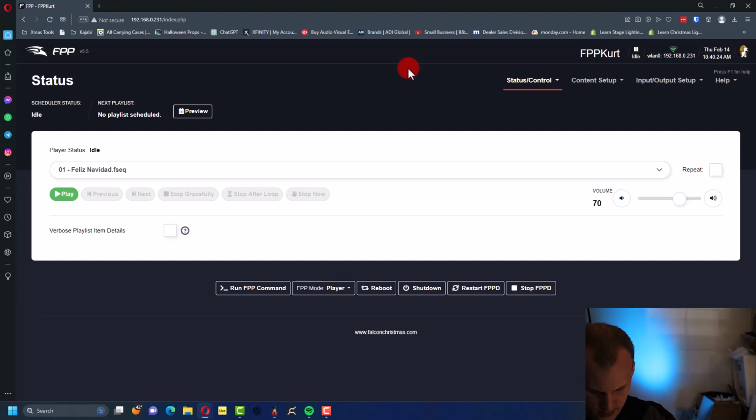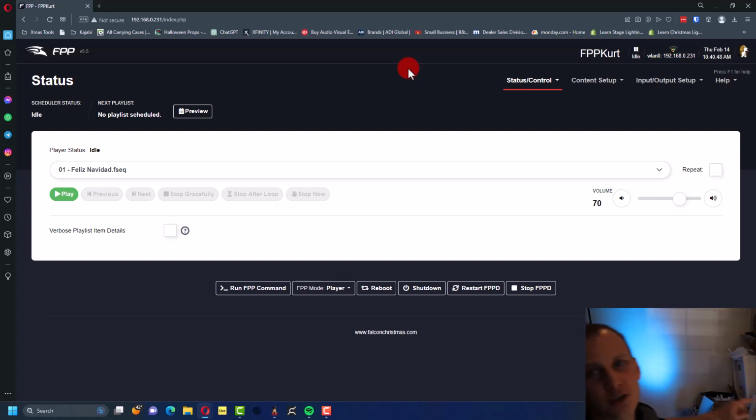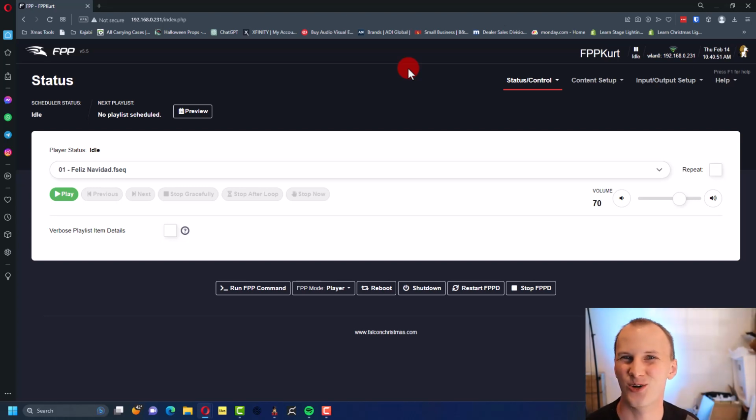Plug that in. Thread it up. I would spray a little dielectric grease in there. That's dielectric is how you spell it. I like the spray stuff, but the spark plug style stuff works too. And same with the X-Connect side to keep the water out. And then I'm going to find pigtail number 1. I'm going to move this against my wall instead of that blue light. And then we're going to go ahead and fire it up.